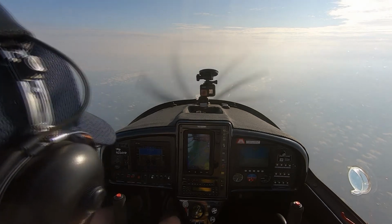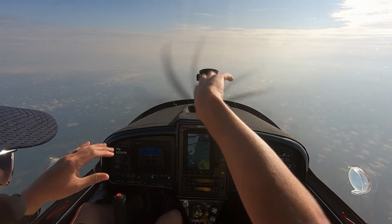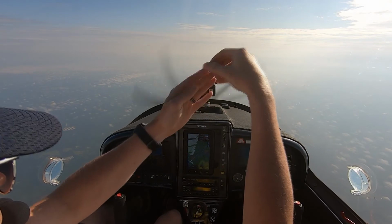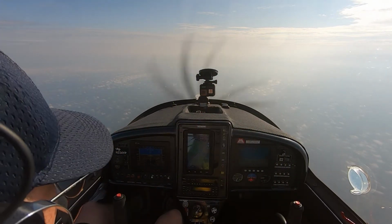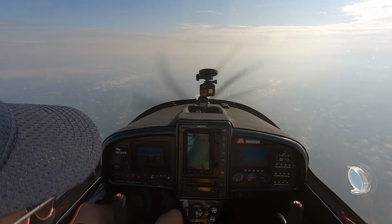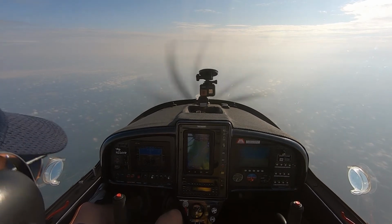So what we're going to try to do this time is actually relocate the fuel pressure sensor up a little higher on the firewall, and that way when the plane is off and the fuel pressure drops, then the fuel will run out of that hose and it won't just be sitting against the sensor the entire time. So we're hoping that will solve it, and hopefully I won't have to replace the fuel pressure sensor in another 2 years probably, like everybody else has had to do.